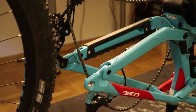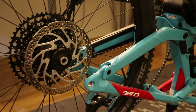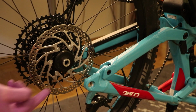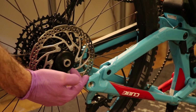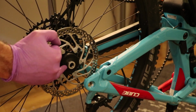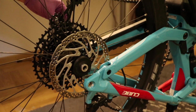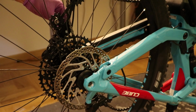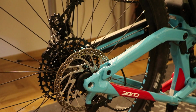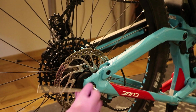So you will just take the rear wheel and aim it into the disc. Also, be careful not to hit the ring gear onto the frame during the installation. This can move it just slightly and ruin our proper installation depth. So, very carefully, just pop it in. Now you will take your axle, place it inside the dropout, and start tightening.